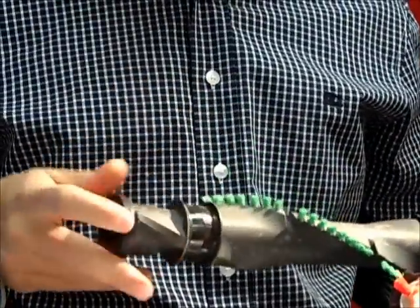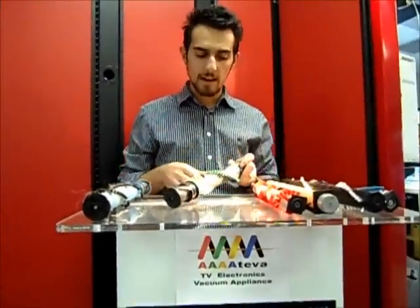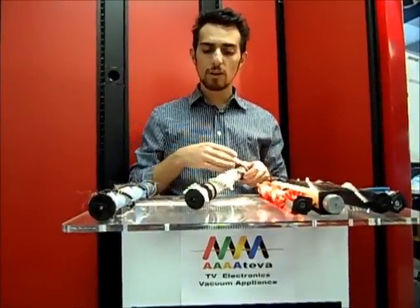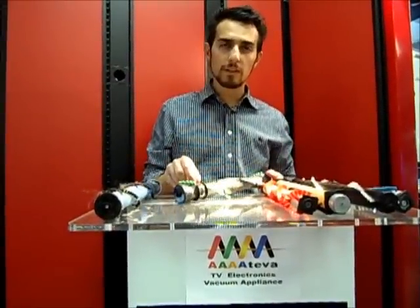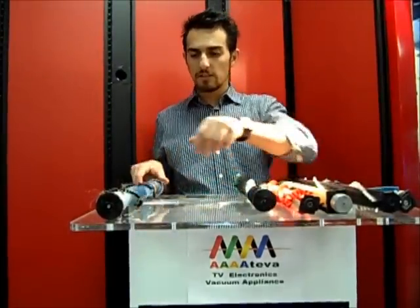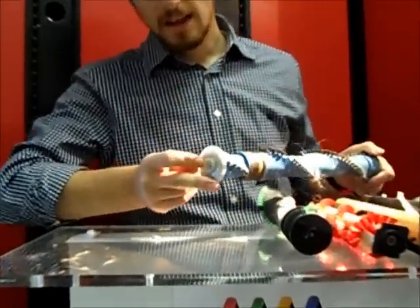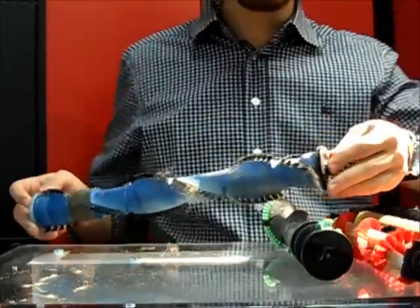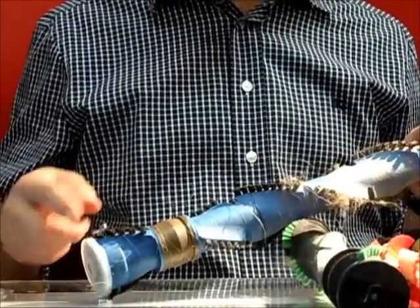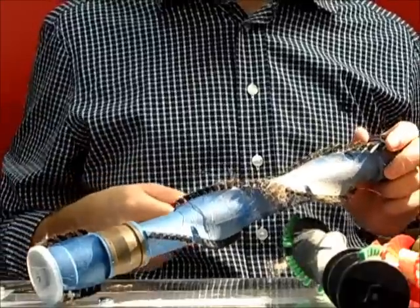It's very important to routinely check the bottom of your vacuum — flip it over and actually take a straight blade and cut out any hair or string to make sure it doesn't get into the belt area or into the bearing area of your agitator. This is another brush roller that's been used, and you can see the brush roller ends warping due to the high speed and obstructions such as hair and string getting into the bearing area.